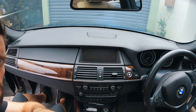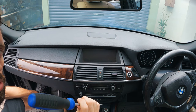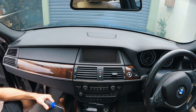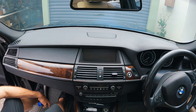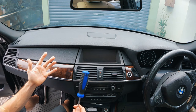If you are looking at buying one of these units for an E70 X5 or an E71 X6, make sure you do read whatever listing you're buying from properly because there are different versions between a CCC and a CIC. The other thing is these cars have an aux input in the centre console and you will have to run a 3.5mm cable — which they do supply — from the aux input through the glove box, probably under the dash and centre console, and into the back of the unit. Alternatively, if you don't run the 3.5mm cable, you'll have to use something like an FM transmitter.